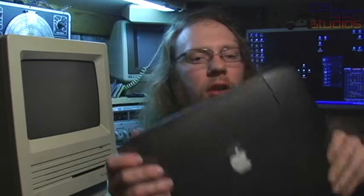You cannot have the SE and your other Macintosh using the same SCSI address for the controllers. If they are the same, nothing works — you won't even be able to boot the other machine. So we need something that uses SCSI as its secondary mass storage option. PowerBooks are a fantastic device that can do this. This PowerBook here has the ability to have the SCSI controller address set differently, and since it's IDE based, we aren't using the SCSI bus at all to boot, so I don't have to worry about ID 0 at all.